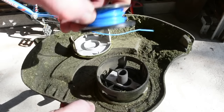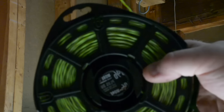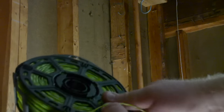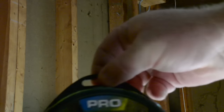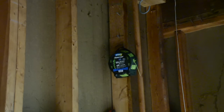This cord or line is maybe three years old and I haven't used a full refill, so I'm going to change two spools. Notice that there's a hole right here — that's where you can put it through a nail to help it spin. I'm going to just unthread this, and then you can see the cord simply comes out the side. Put this on a nail — this little hook piece — and then you can easily pull your cord.